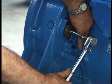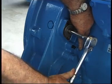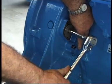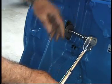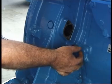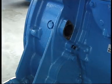Turn the rotating tool slowly at the same time as applying a light finger pressure to the bolt head. When top dead centre is reached, the bolt will enter a threaded hole in the front face of the flywheel. Screw the bolt in as shown.